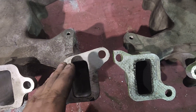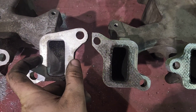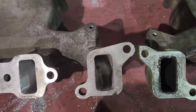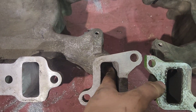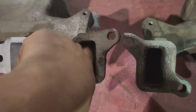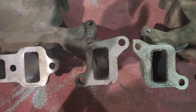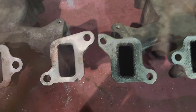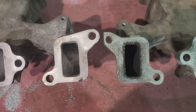The intake really isn't as important as port matching your exhaust, because this flows into the bigger cylinder head hole. But of course, anytime you can open it up and just get more air in smoother — again with all the radiusing, making all my turns smoother and more free-flowing — that's always going to help, especially cramming a bunch of boost into this thing with that big S-475. Right there you can see the difference between the two ports.